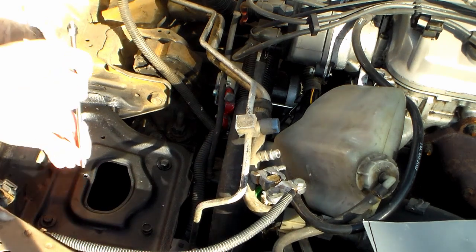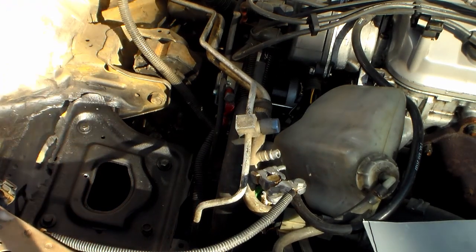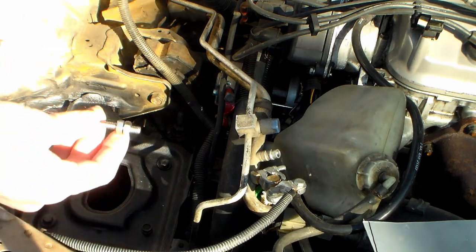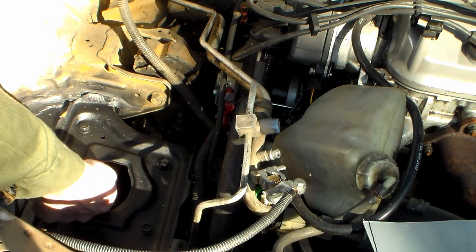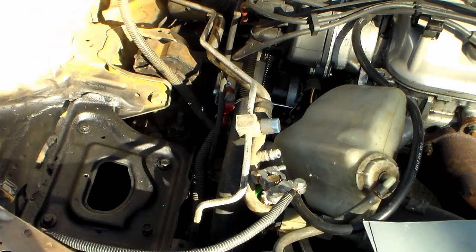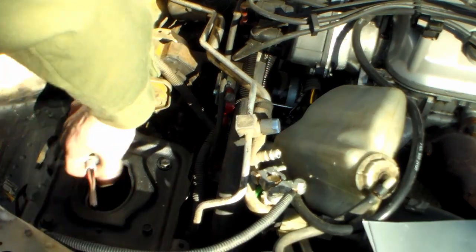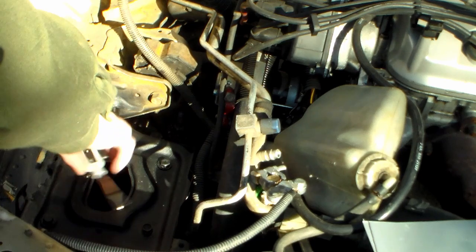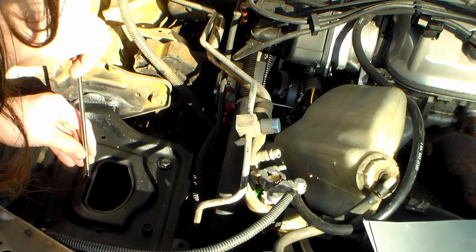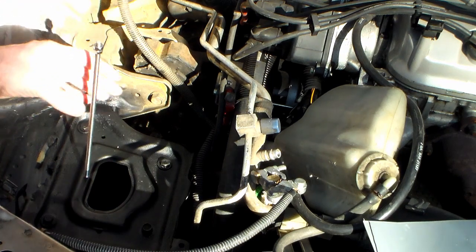Our hole is drilled. I'm checking if it's big enough — we could practically thread that hole. I'm going to do that for the extra advantage because I'm going to put some washers and nuts under the bottom and on top, and threading the hole will give better control. I need an M6 1.0 tap — there it is. I'll run the tap through here. That gives me extra control over where I get to position that rod.